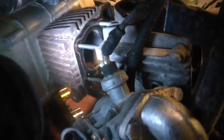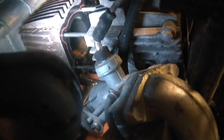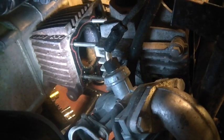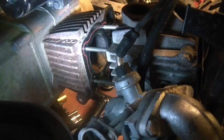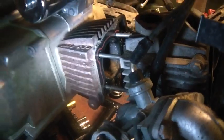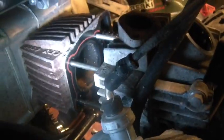I think I'm going to be frugal on this one. What I need to do is finish taking the engine off, then I'm going to clean up the bore — I'm going to do a somewhat sloppy job on this. Clean up the bore, clean up the rings, and hopefully they're going to free up and hopefully they're not messed up too bad. Then I'm going to slam it all back together again and see if I can't make it run. So I'm going to do a wham-bam job on this thing.